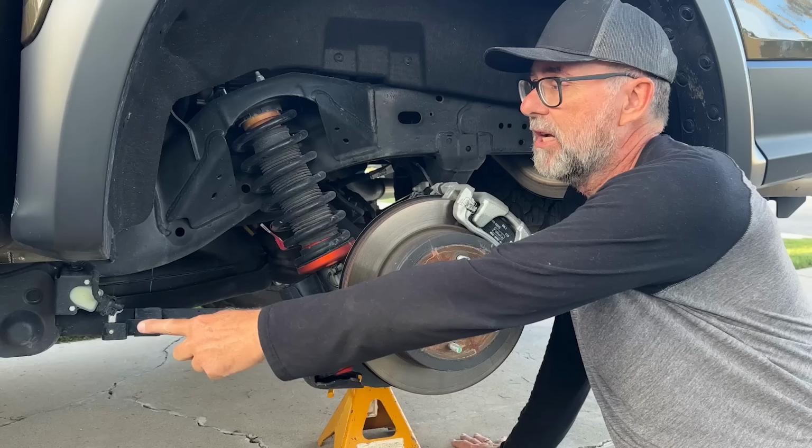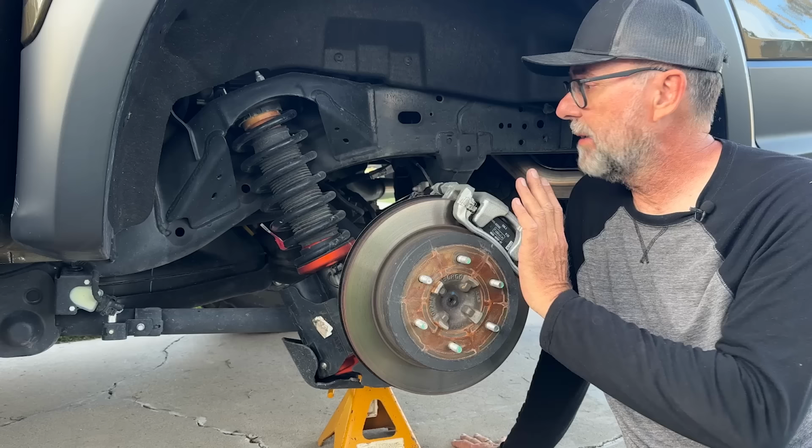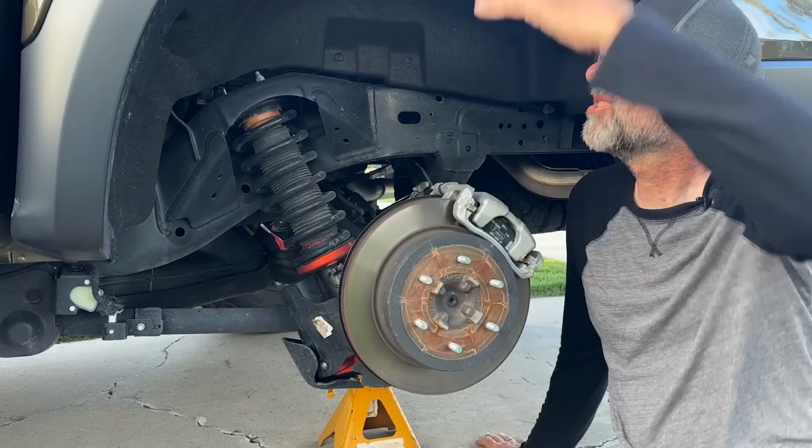You can see the lower one here, the shrouded front pivot, and then the rear pivot we'll see from another angle. The upper link is a little bit hard to see because it's behind the spring on the other side of this frame rail. But a typical thing, here you can see the breather tube for the axle. This has, I think, a 37-inch fording depth, and the tires are 33 inches tall. So the top of that tube's going to end in the sides of the bed here somewhere pretty high.